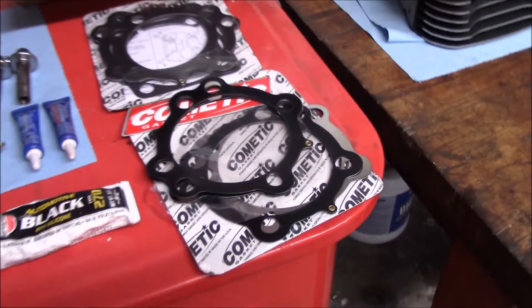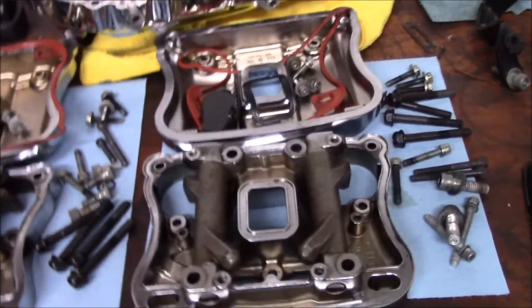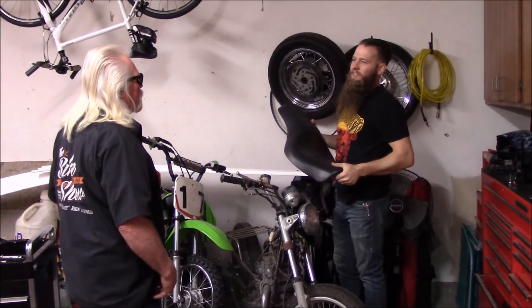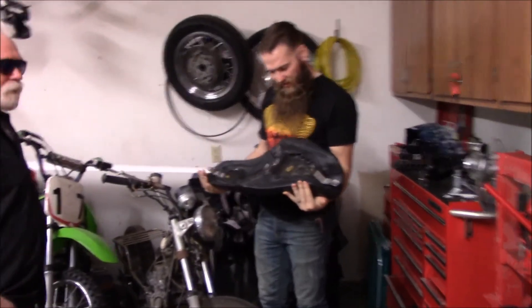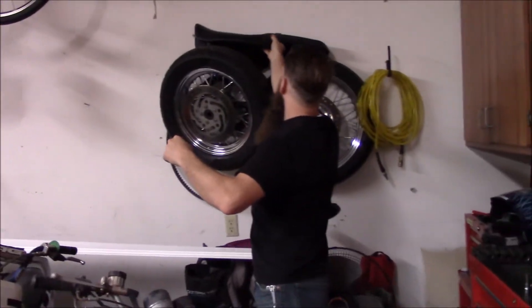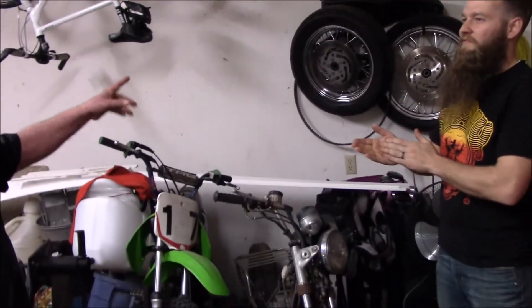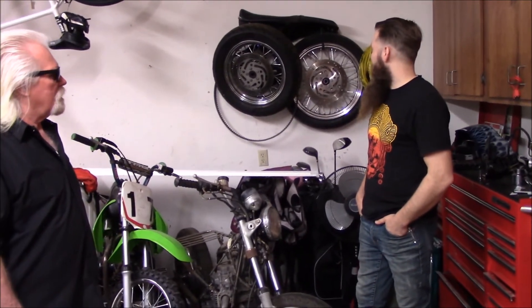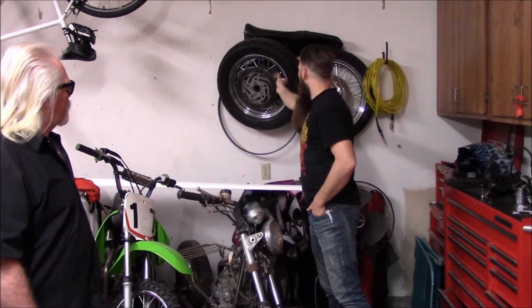What's the seat? I think it's mostly stock — might be the original seat. When the previous owner first got this bike I actually helped him hollow out the baffles and put some tonal steel rings in the back. He only rode it for a few weeks and the spokes got loose. Down at the Harley dealer they wanted a bunch of money to redo the spokes, so I got him a spoke tool and showed him how to go around and tighten them. I should probably tighten them up now too — I always wonder about high horsepower with a spoke rear wheel. I would always tear the spokes up. We'll have to see if they hold up with this kind of power.